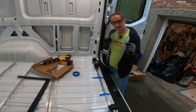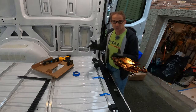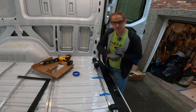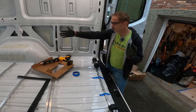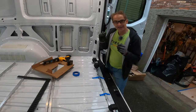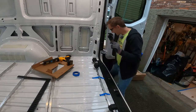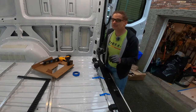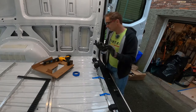What I really think — and this is just opinion — is that if a water tank floods the subfloor, and we've removed the paint from maybe more than a hundred places, we've removed the rust protection from underneath. People in Sprinter vans worry about rust quite a bit anyway. So that's why I've made the choice to leave the paint. I really don't know that there's a wrong answer, but I am leaving as much of the van as I possibly can fully pristine.